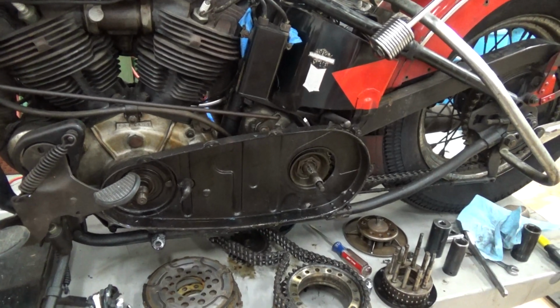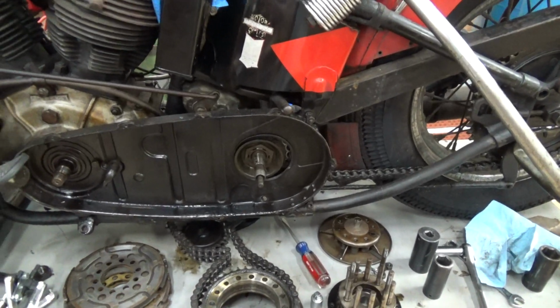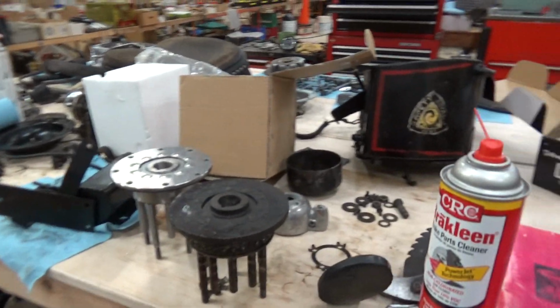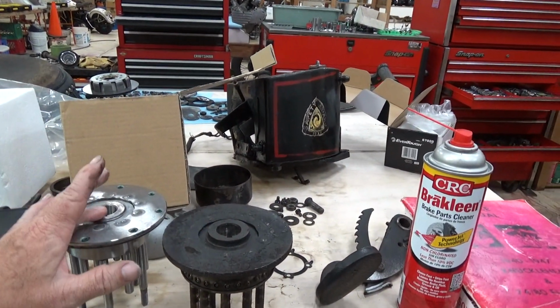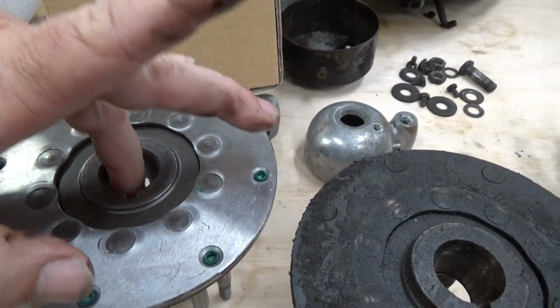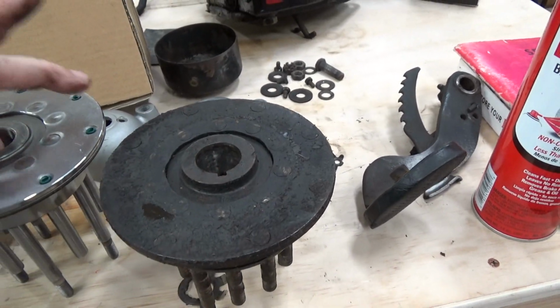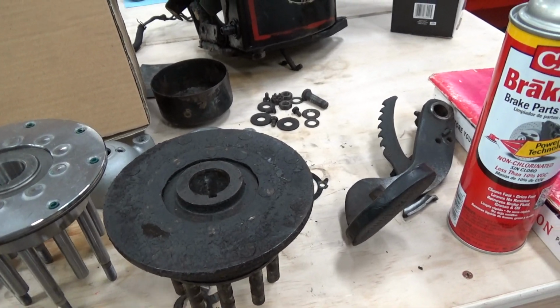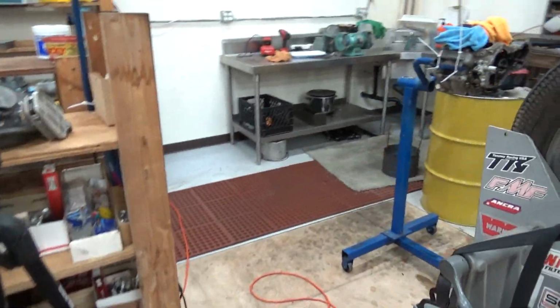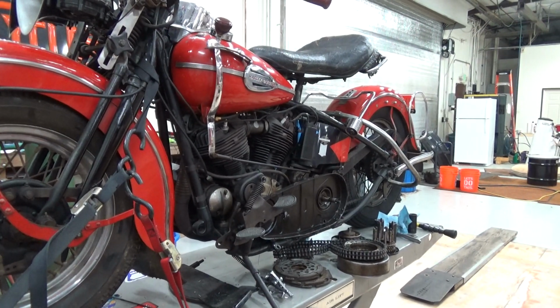Yes, I did. So, the whole concept of this video, besides discovery, is can we take this aftermarket clutch hub and mount it on and have clearance. Again, as you'll see, this does not have the depth of shaft as the stock one. You don't have to have all that depth of shaft. It's not really needed. That's why they didn't spend the extra time and material to machine that, which saves them pennies per clutch hub, but when you manufacture thousands, it actually makes you money.